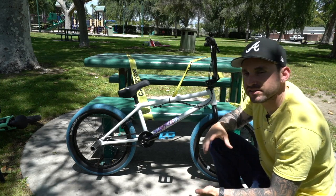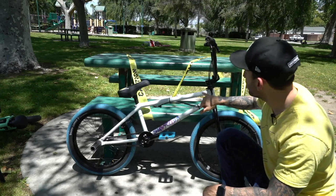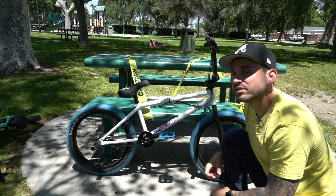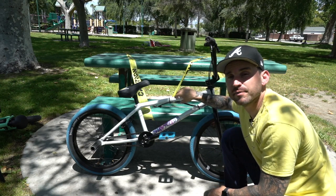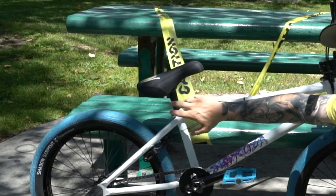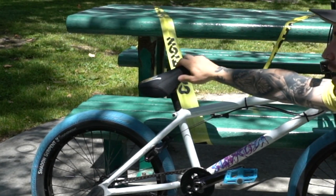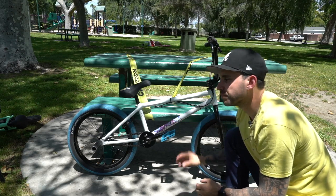As you'll see in the close-up shots, the aftermarket frame comes with an integrated seat clamp, welded gussets, and different tabs that add strength. Assembling these bikes takes more time, so obviously the price goes up. The paint jobs are also a lot nicer — powder coated with very durable paint that actually adheres to the metal and lasts a lot longer than the paint on complete bikes. I currently ride the pivotal seat design, so I can put an allen key to the very top and adjust the angle of my seat post. The seats are also triple or even quadruple stitched, so they last longer.